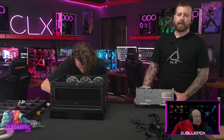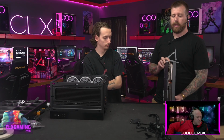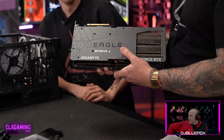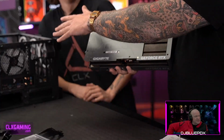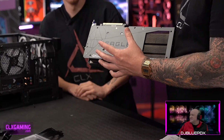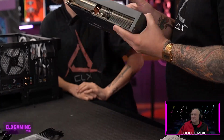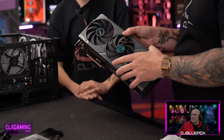Now, obviously, this card's going to need to be cooled a lot. That's why it's got all that framing in there. How does that work? I mean, you can see those copper tubes in there. Yeah, the idea is on the back of your video card, you're always going to see like 4 screws kind of in a square like this, which is very similar to your motherboard and where your CPU mounts, because our GPU is right here. So those screws are what's really mounting the cooler to the GPU itself, and then the heat's extending out past that. So we can show you what that looks like under that heatsink on our handy dandy 1050 card.